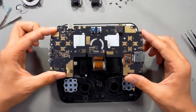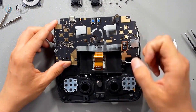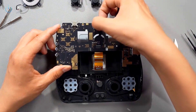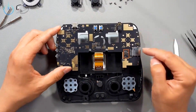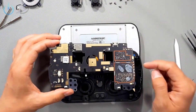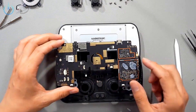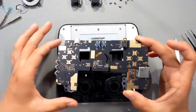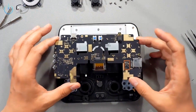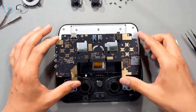At this point we've also removed the motherboard. As usual with Brother Zhou's designs, there are four small corners, which makes it especially easy to modify with micro-switches. If you think a slider phone like this should have that micro-switch feel, it's pretty easy to modify — just solder a few small micro-switches on. The feel of the double S key this time is actually pretty comfortable, so there's really no need to modify it. Over here is the TF card slot, this is the microphone, and on this side are the volume and power buttons. On the other side is the CPU, and the memory — or you could call it the hard drive. There are also some connectors here that I have absolutely no idea what they're for. The level of integration on Brother Zhou's motherboard is still pretty high, but not as high as his RG-Cube, which just has a tiny little board. I think this machine was probably designed this way because of the space needed for the two joysticks in the middle — otherwise, a single board in the center would have been enough, with two small subboards on each side. A lot of these design compromises are really just to serve the appearance.